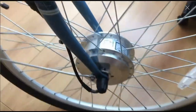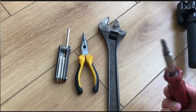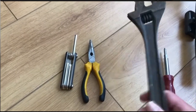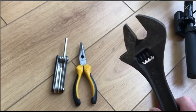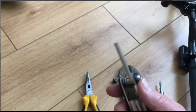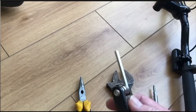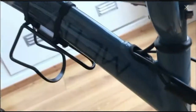So we need to take this off somehow. These are the tools you need — this is one option anyway. You need a Phillips screwdriver, a decent one, for the cable retaining screws on the frame before you take the front wheel off. You either need an 18mm socket or a wrench like this with good jaws, so that you don't round off the axle nuts. You need this to slacken off the brake cable for the front, so that you can unclip the cable from its holder. The brakes then just fall apart to allow the wheel to come out easily — you don't have to take the cable off or anything, just unclip it and put it back in. But to give yourself some leverage for the tension on the cable, you need those pliers.